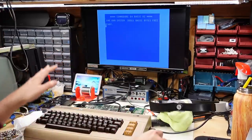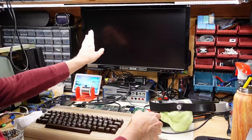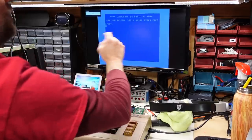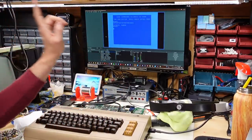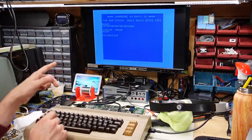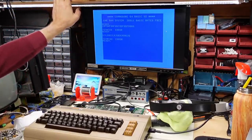This machine gets jail bars, and sometimes when you power cycle them they go away. Usually every other time is jail-bar-free. There it is — no jail bars, or almost invisible ones. Let's switch back to the DVI input on the monitor and see what we've got. It's working! When it was screwed up before, you'd sometimes see an image but as soon as you started typing there was so much delay — because of that USB 3.0 data problem. But now look at that — it's freaking working! That is such a relief. That is what I needed this machine to do.